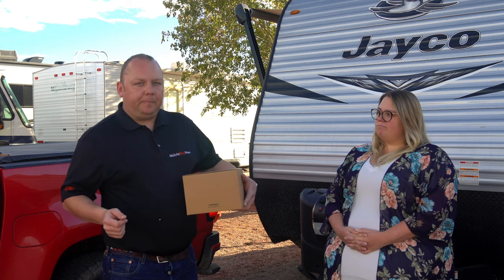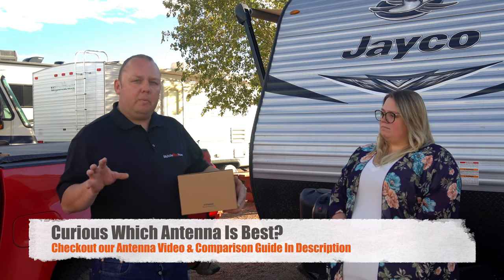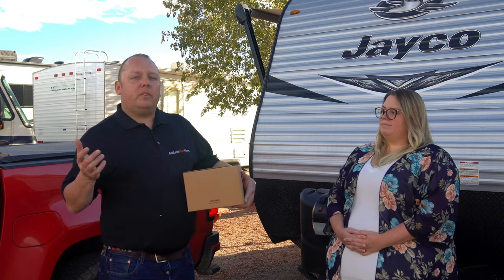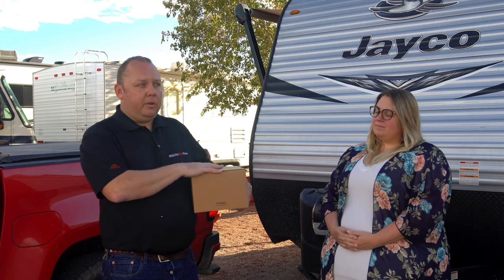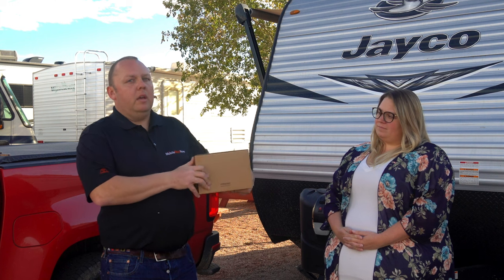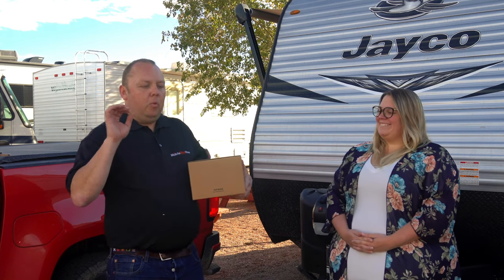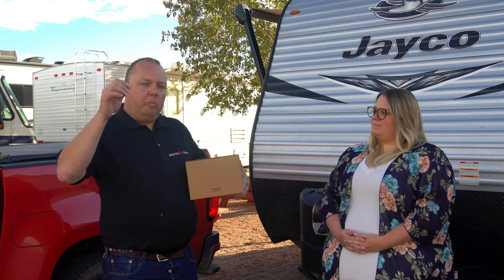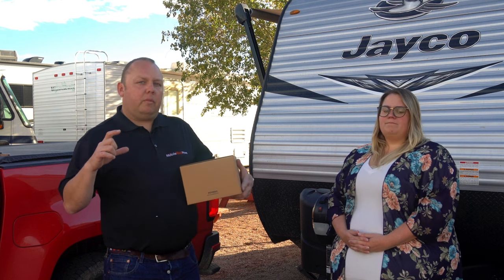The Mobility 42 is ideal for our 5G BR1 Pro modems, our Category 18, or our dual modem Category 12 like the Duo and the Transit Pro E. If you have a BR1 Mini or BR1 MK2 — a Category 6 modem with only two antenna leads — we'd recommend the Mobility 22G to save money; you don't need the seven-in-one, you can go with the five-in-one. For tools, we're doing a surface mount directly on the roof. We'll need a one-and-three-quarter-inch hole saw, a drill, and a three-eighth-inch drill bit — a long bit for a pilot hole.